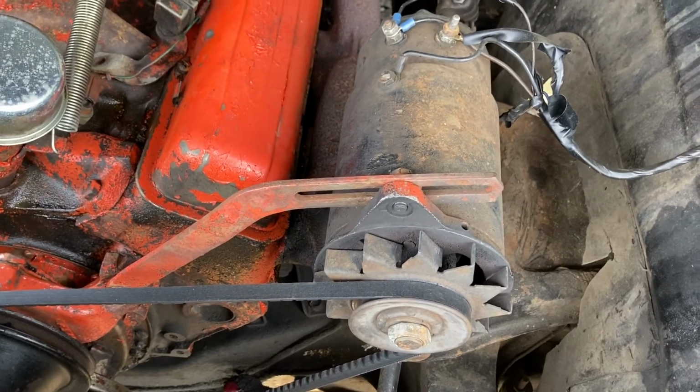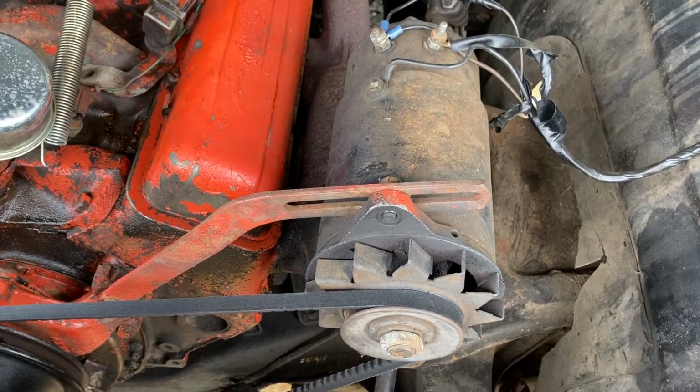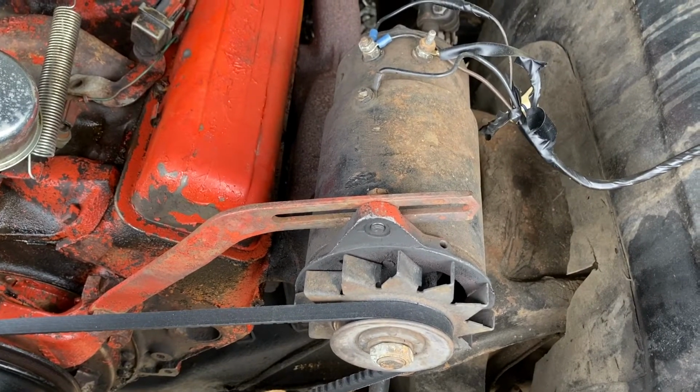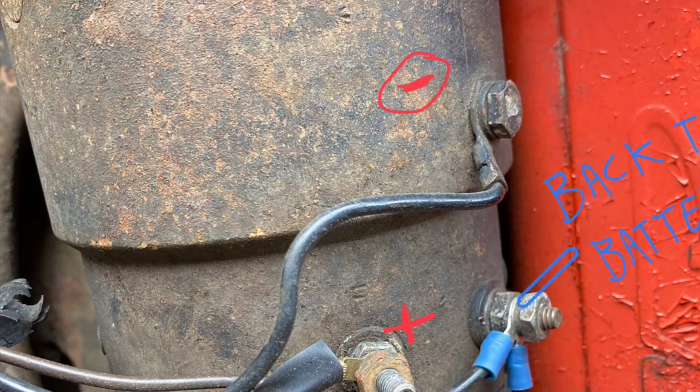All right. It's squeaking a little bit, so I'm going to take it apart and change the bearings, which should help me and maybe you too learn a couple things. All right, so the connections here, you've got a positive and negative that charges the electromagnet or field coil, and you've got two wires that go back to the battery, back to the regulator.